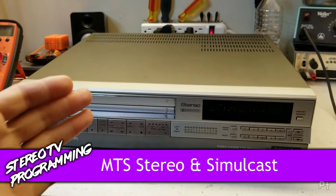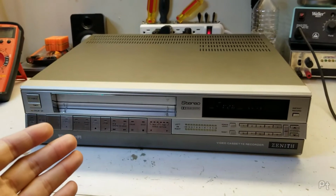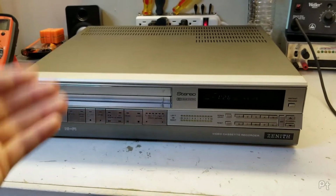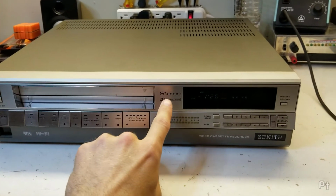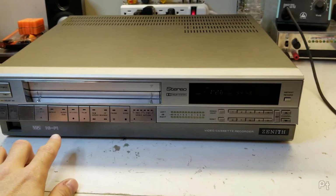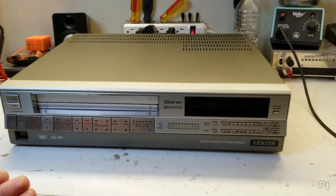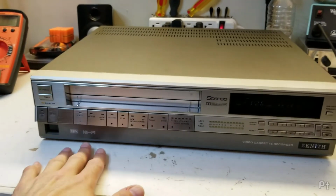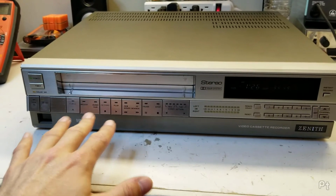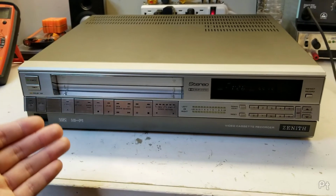So regarding both stereo formats, there's a little bit of a gaping problem here. If you were to buy a pre-recorded movie or rent a movie, most were encoded in both linear stereo and hi-fi after 1984. So great, wonderful, you have wonderful sound. But what about TV programming? Well, hi-fi obviously will give you very good sound quality, you know, great frequency response and everything recording from TV. But TV wasn't stereo back then.